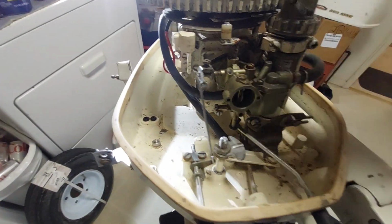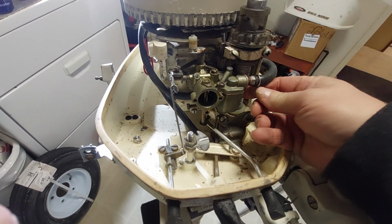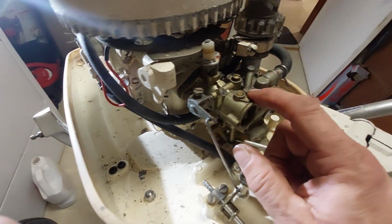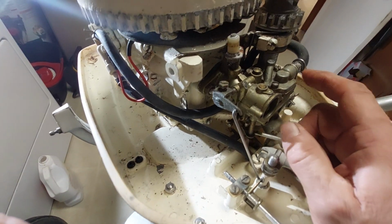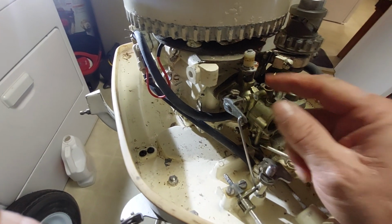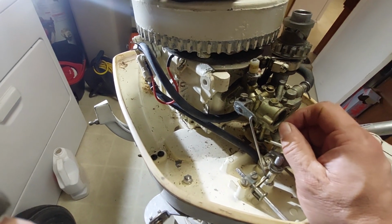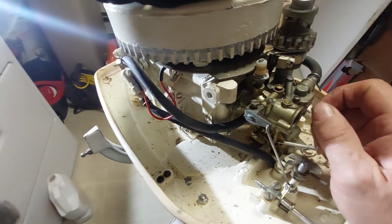Also, another thing I'm going to try with the 9.2s, because they're painfully slow. I'm going to take this carburetor off, and I'm going to put, this is a Tillotson, but I don't care for this style. I'm going to put a MD series on it. And the throat's the same. The only thing I might have to do is get my point of opening to time out different, because it's got a little different pickup. We'll see what I got to do.